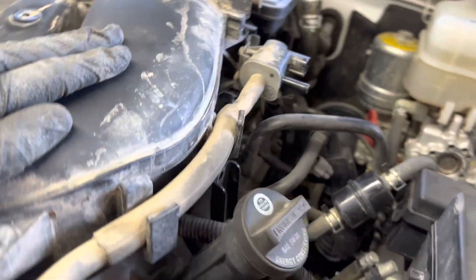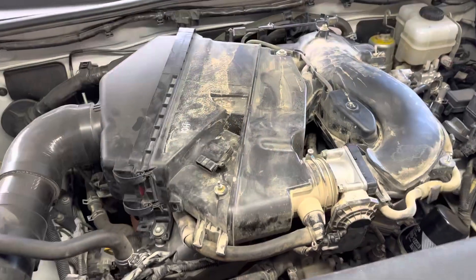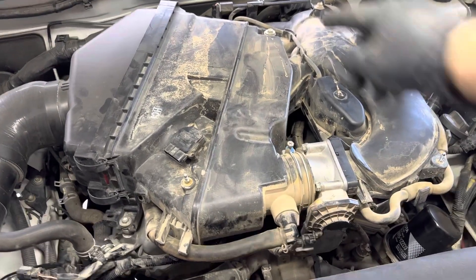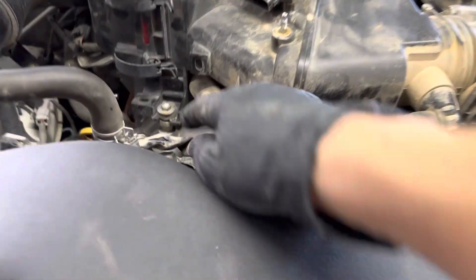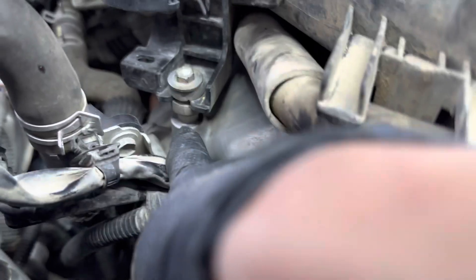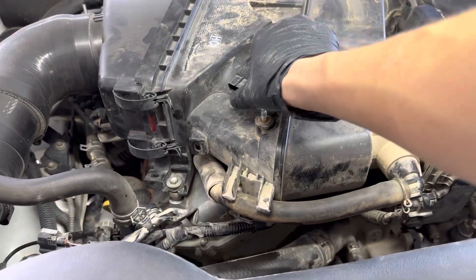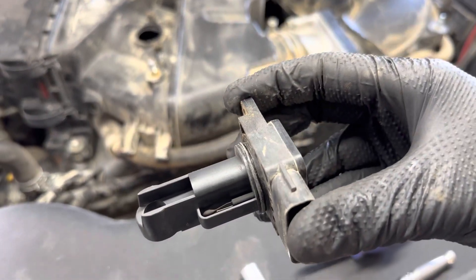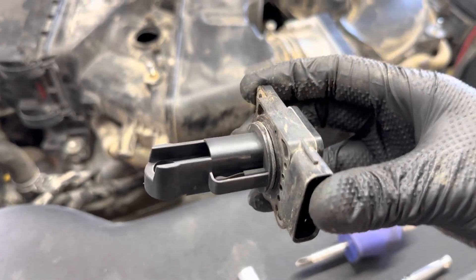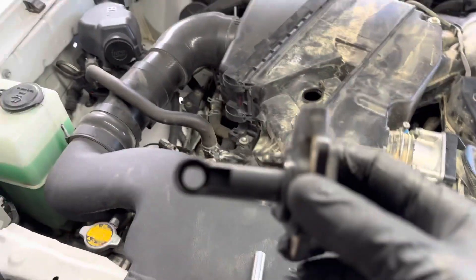Next step is finalizing this side and the reinforcement brackets. We've got the intake bolted back up, the 10mm in the back, 10mm on the throttle body, and the hose connected. I made a small little washer down here just so the box isn't pinned sideways — it didn't come with the kit but I trimmed down some plastic real quick. I also always clean the mass airflow sensor when I've got it this far. This one's pretty dirty — it's just good maintenance to do while it's out.